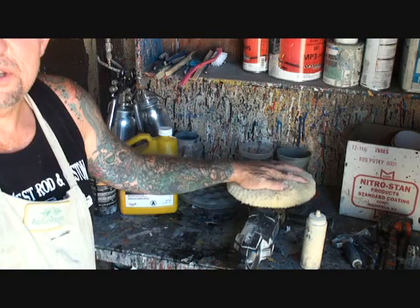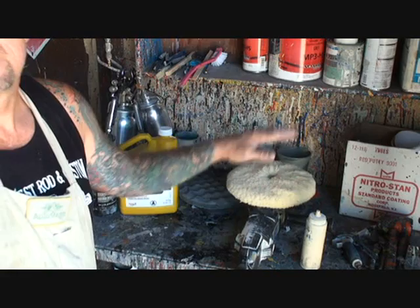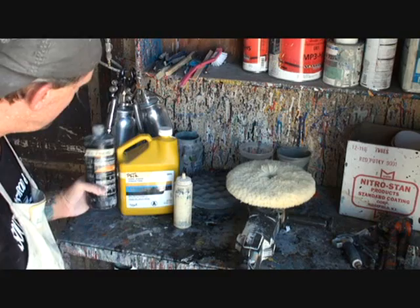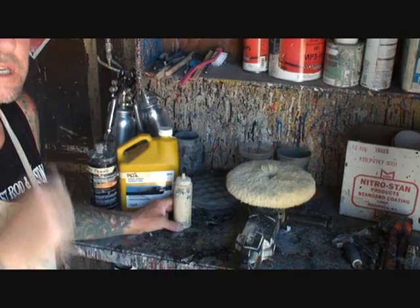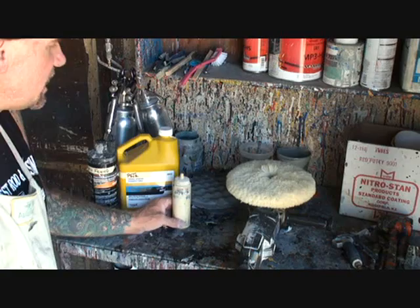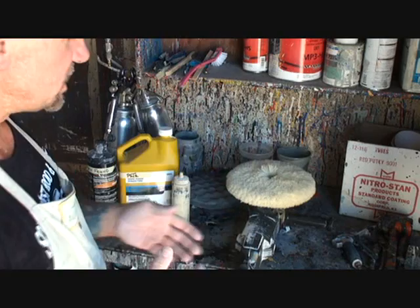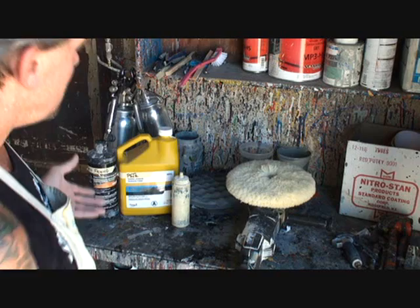That's where you're saving money. If you only take it to 1,500 grit, that's going to take one-and-a-half to two pads to do one car. I'm going to save on rubbing compound and final finish foam pad glaze because I took it to 4,000 — I'd use two-and-a-half to three times as much if I only did it to 1,500. I'm also going to save time buffing — it's going to take me one-third the time to buff this panel. Always keep in mind that you can spend a little extra money on sandpaper, or spend a lot more time and money on materials.